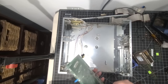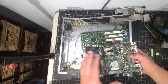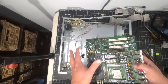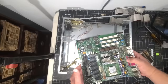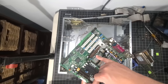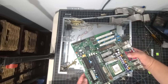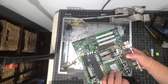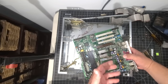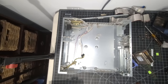There was very little to no dirt underneath the board. Some people comment that I'm not cleaning under the board during a full restoration — well, the proper way is to remove it and get everything clean. But most times I gauge the system by what I see around it, and decide whether or not to remove the motherboard because sometimes you can cause more damage than it's worth. All the capacitors look really good — there are some bent ones I'm straightening out, and you'll see them around the CPU. Lower-end capacitors near a heat source can cause issues. Everything looks good, so I'll put it on the antistatic mat.